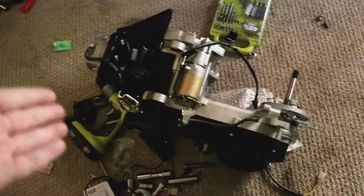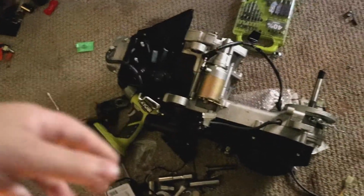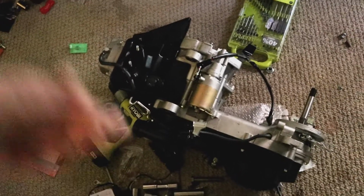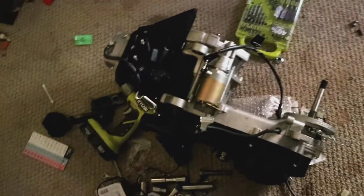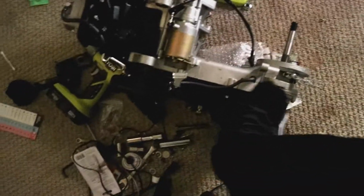So because our engine was unfortunately not the right motor, we actually are going to reuse the old one, and we actually found out that there was only surface rust. We were able to clean it up, get it cleaned up nice. Everything inside of it is in great shape. We took the head off, the valves look fine, everything looks good. So we're actually going to use the old motor. We thought it was blown. Turns out it was being leaned out, and that's why it sounded like it had a bent valve going on. So because of that, our old motor's good to go. So we're unfortunately gonna have to flip this guy.